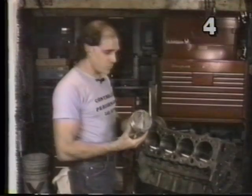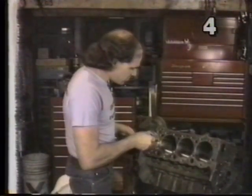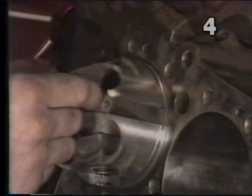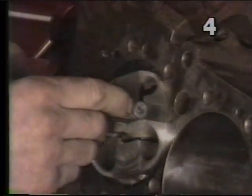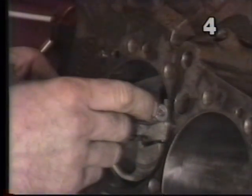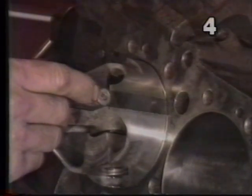Now that we've reconfirmed our relationship of piston to cylinder combination, we take our four thousandths gauge, lay it alongside our piston, and insert the piston and gauge together in the cylinder simultaneously. We notice that the piston moves very freely with no binding — we know we have at least achieved proper minimum piston-to-wall clearance. If you experience binding with the minimum recommended clearance, the cylinder should be honed out to attain at least minimum clearance.